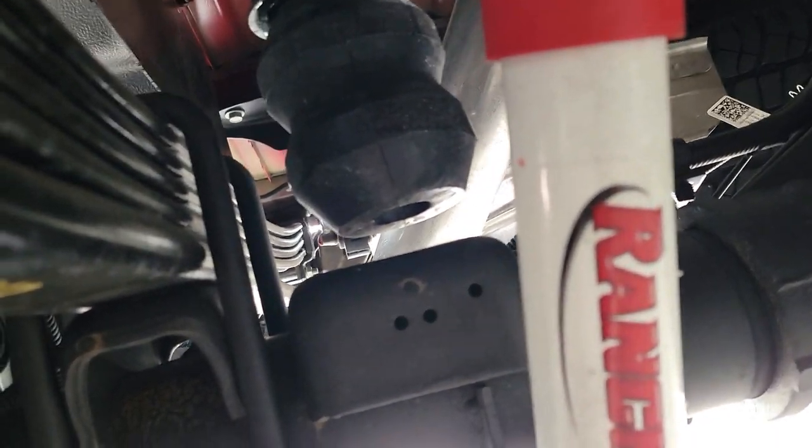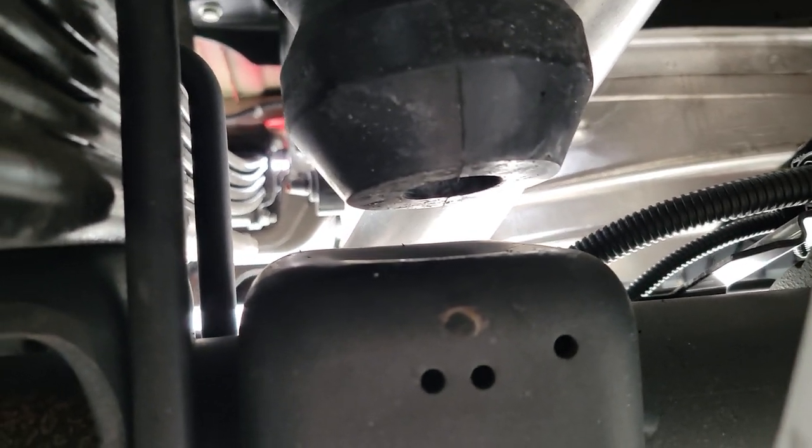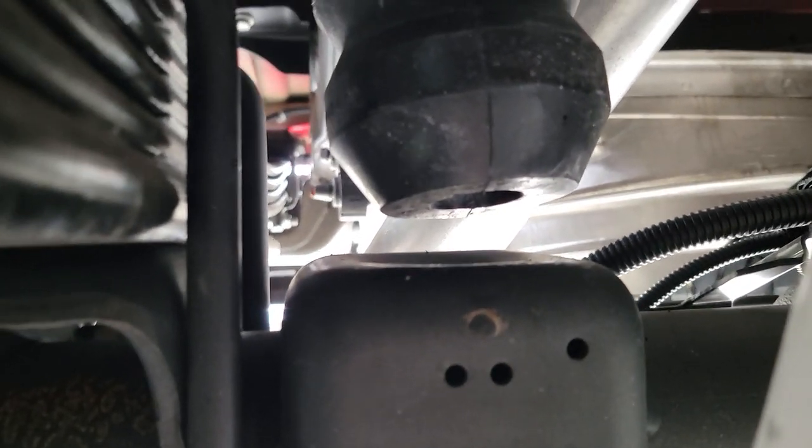You're just going to keep working it until you get that upper lip in there. This is a pretty hefty screwdriver — I have a nice pry bar but seem to have misplaced it. Once you get it snapped in there, right now it's not even fully snapped but we've got at least an inch or so and you can see how it's concave. If it's already touching with no weight in your bed, you might have got the severe service ones — you don't want those for a standard truck.